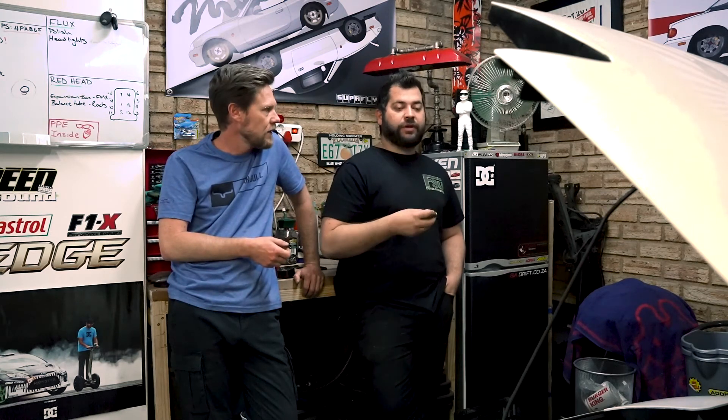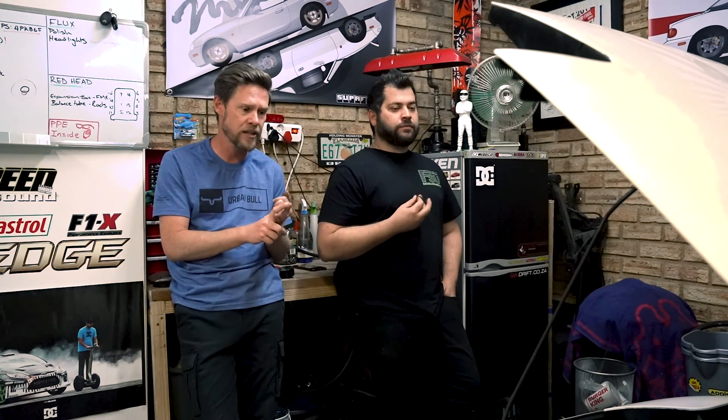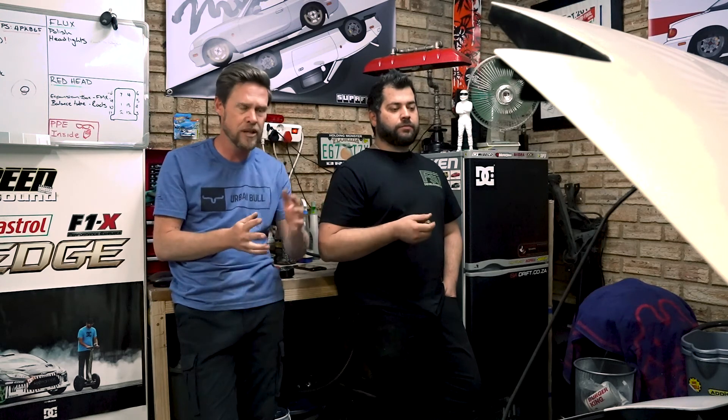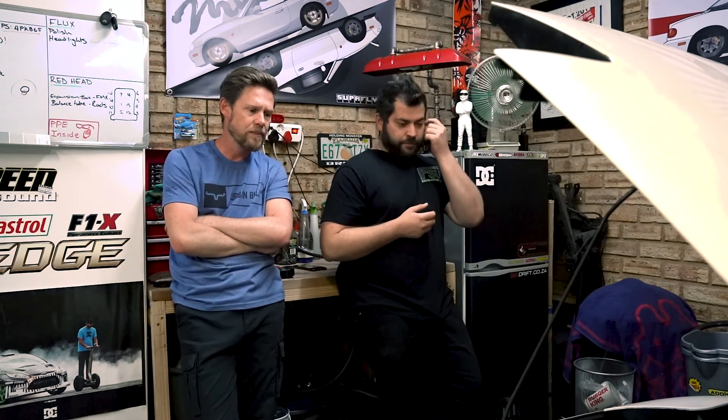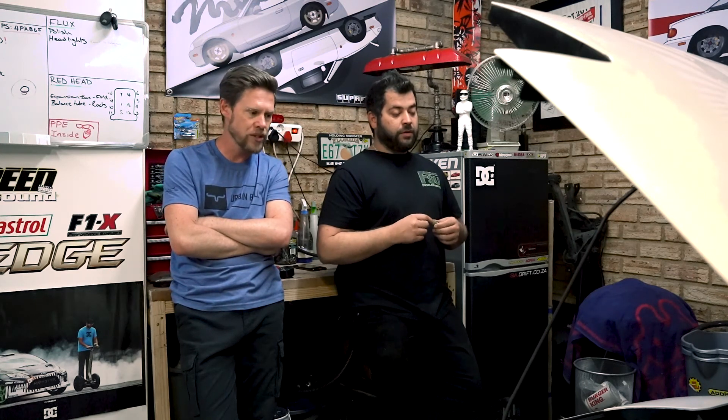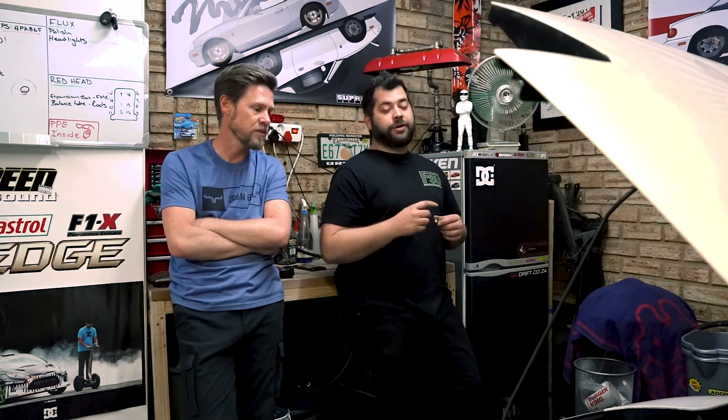I've followed you before and never seen any white smoke, so it's not burning. I think that head gasket is good — it's not bleeding into the oil galleys, and it's not bleeding between cylinders, because then we would have had two adjacent cylinders down on pressure. We've done this cold, not a hot engine with oil resting up by the oil rings helping seal things off — this was a pretty much bone-dry start. We're going to have to keep digging, but bittersweet. Maybe the radiator is leaking — one of the side plastic tanks? We could do a pressure test on the water system, and I think that's probably the next port of call.